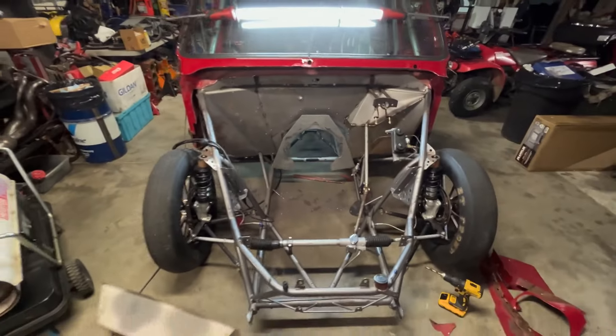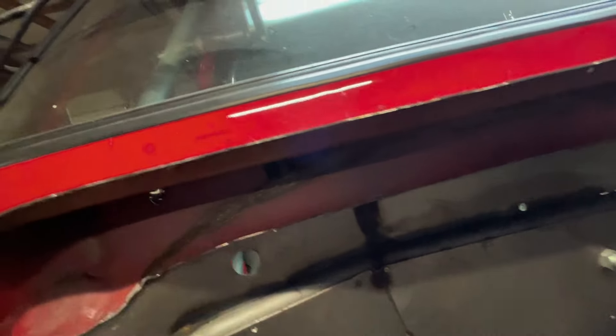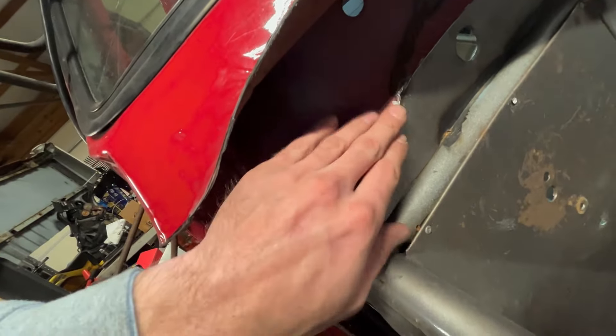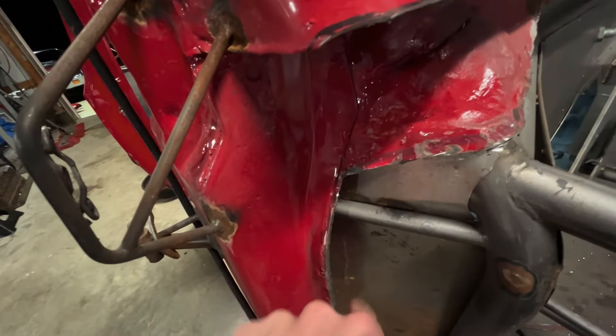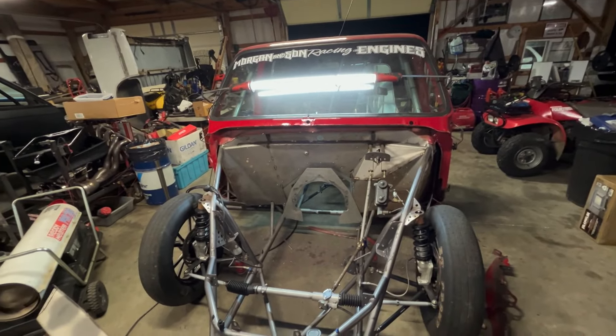Keep chop, chop, chopping. We're getting close up here. Still chopping away at it. It's hard to get that cutter up in there. I cut around here, kind of beat on it with a hammer a little bit, got it awfully close up to that gap. We'll probably touch that down a little bit, hit it with the grinder, get it close, beat on it a little with that body hammer, and then we'll weld up through there — weld it all back together so that nothing can get into the firewall or inside the cabin.